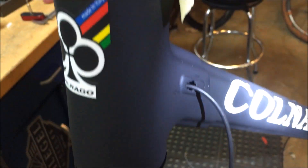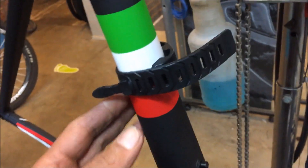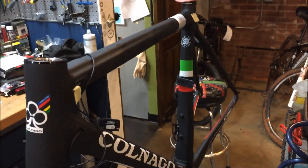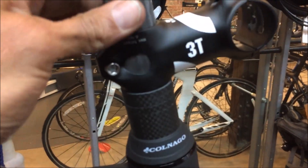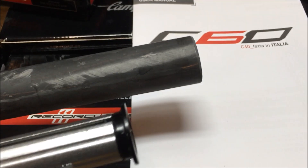The rest went to the seat tube and into the chainstay going outward. That one little hole was a real pain to get the wire through — I actually had to take a jeweler's file and take just a very slight amount of material off to get the wire through; it was a very tight fit. That was really the only difficulty in the whole build. Got all the rest of the wires routed, then you pull the little magnet off the battery. It has a little strap that attaches to the frame — that's your on/off switch essentially.